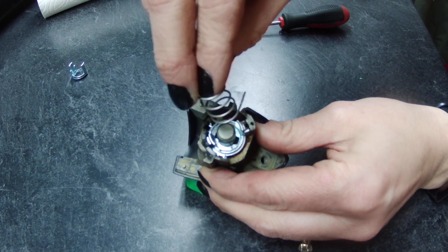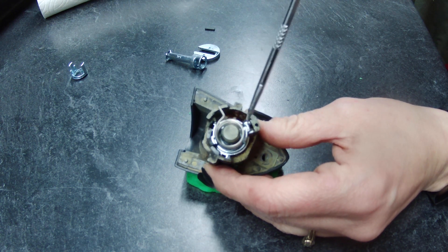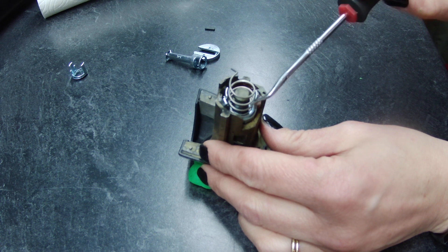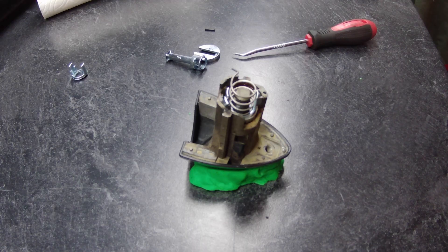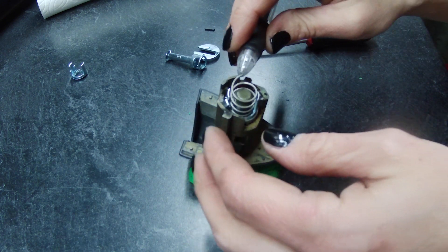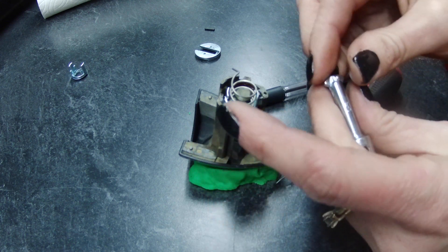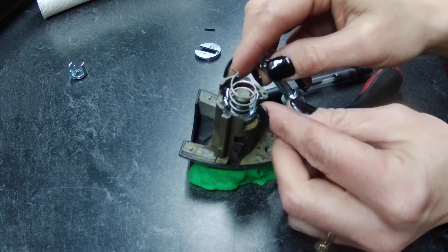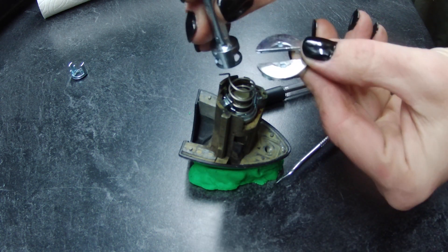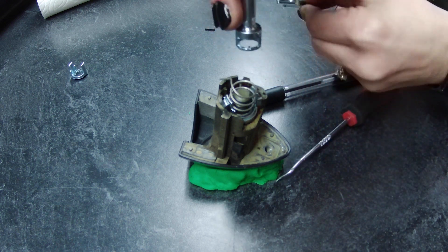Next comes the spring, and this is actually the trickiest part of the whole process. You have to put the spring down in here and turn it slightly so the notch on the bottom catches on this ridge. Then push the spring down and turn it so the top notch connects on the opposite side of the ledge. There's a lot of tension on the spring which makes this so difficult. A lot of people recommend using a ballpoint pen hooked on the ledge to help control the spring as you push it down and turn it. Before doing that, grab the pedal — when the spring is pushed down, the pedal has to be placed over it, positioned correctly so the U-clip hooks through the notches of the pedal and keeps everything connected.